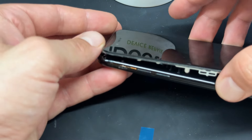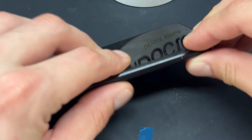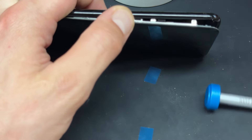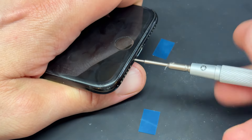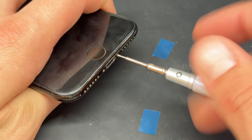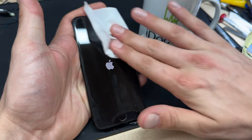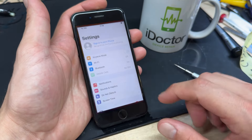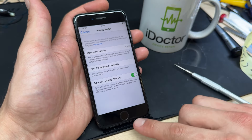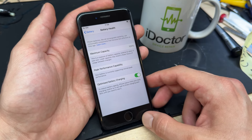To secure the screen down, make sure it lines up at the top of the device first, then squeeze it in on the edges — just make sure this flex cable doesn't get snagged in the chassis or nipped by the screen, as that will cause problems. Squeeze it in before finally reinstalling the two pentalobe screws in the bottom of the phone. I'll use a little bit of isopropyl alcohol and a clean wipe to clean up the screen. Then head to settings and make sure that the battery health has been updated in there, and that just about completes this replacement of the iPhone 7 battery. Thank you for watching — see you next time.